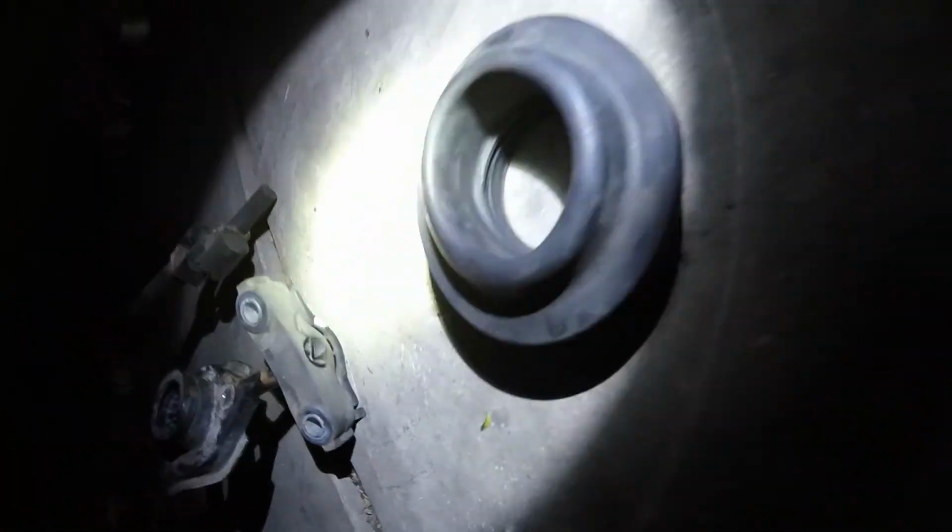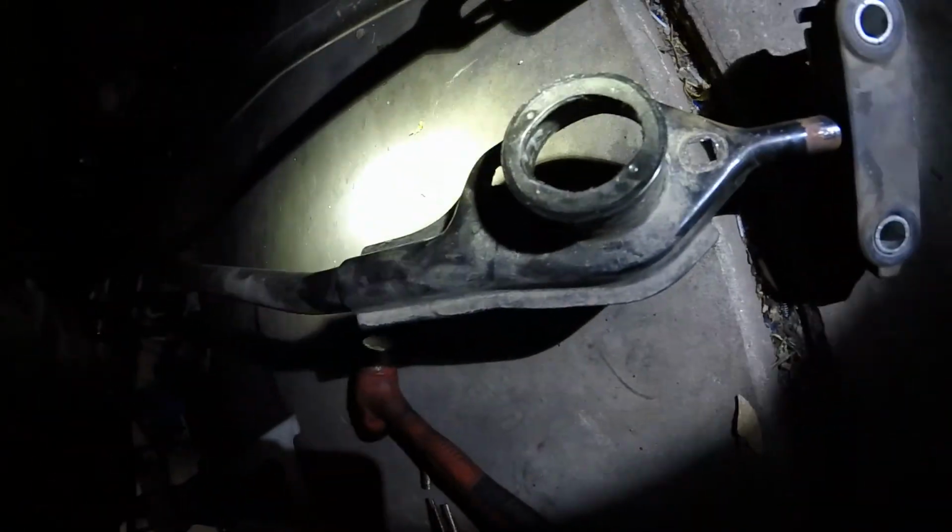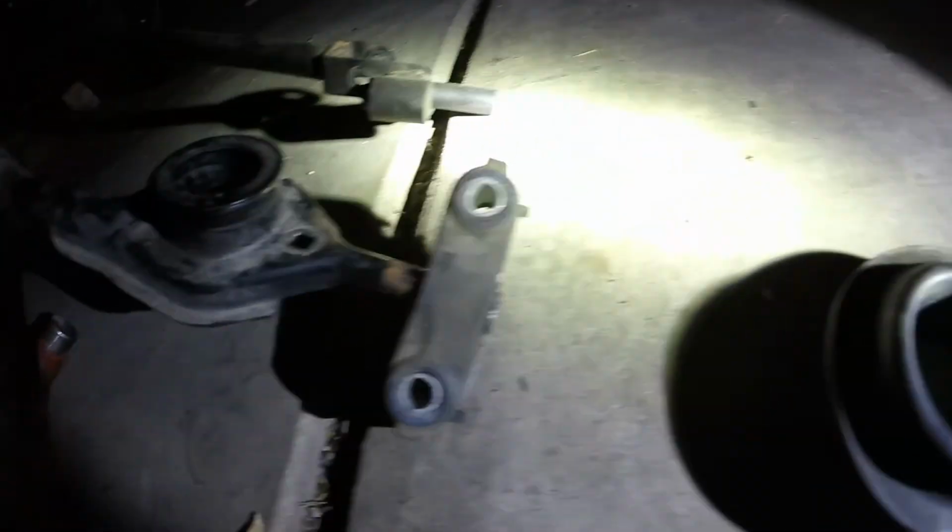So here's what we're dealing with. You can see there's a hole there on the back. This rubber boot comes off, and then the Hybrid shifter just covers the centerpiece up. And then there's another hole over here. And if you want the 3rd hole, you can see where I've marked it right in here. We'll have to drill that out. So that gives you the 3 locations. So I'm going to go ahead and drill that out. We'll mount the shifter to this, get this back up in the car, mount it to the shift linkage, then we can go in the car and finish the install.